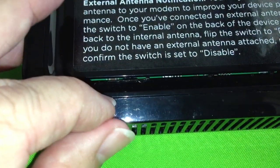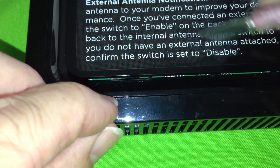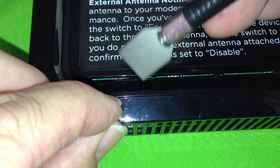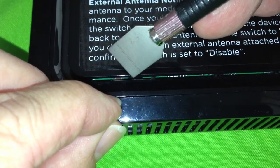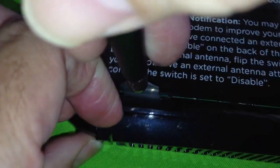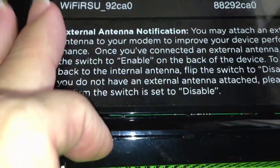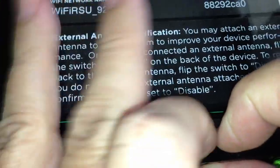What you need to do is get your finger in there or something and start to pry it open. The trick is, if you look inside you'll see a little black tab in there. You need to find something thin like this tool here, go in there, push on that tab and it'll pop out. Then repeat the same thing on the other side.